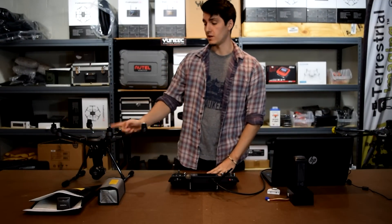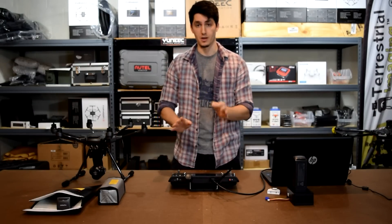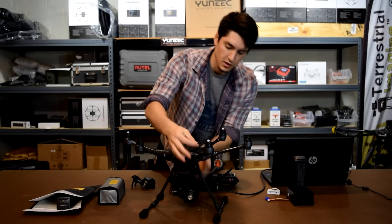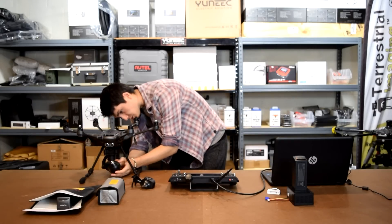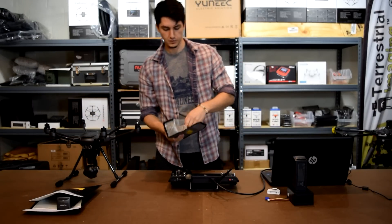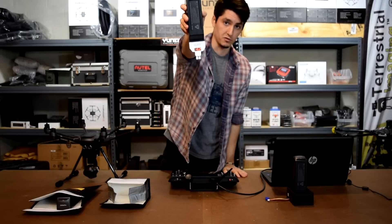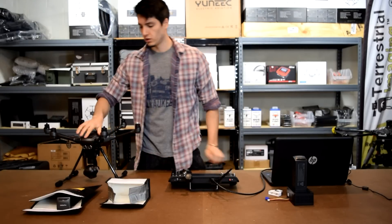So now we're going to start the update for the Typhoon H. What you're going to want to do is take your microSD card that has the firmware on it and put that in first — do this before you do anything else. So take off your gimbal guard, put that to the side, and on the back of the camera there's a microSD slot. We're going to put that chip in. Be careful because it's a little springy and it can shoot out just like the controller. Now that my chip is in, I'm going to take my battery out of this LiPo safe bag. I'm going to make sure my battery has some juice using this little meter — we've got 16.2 volts, so we're all good to go. I'm going to pop my battery in and turn my drone on.